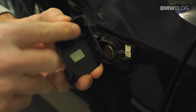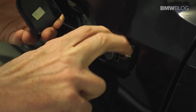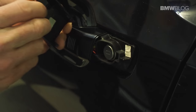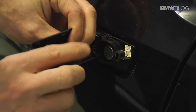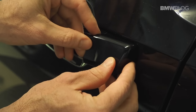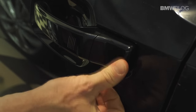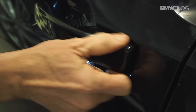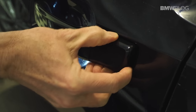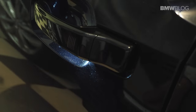I find if you look at these two little notches here and you hook them in here and snap it down, that it works a lot better and then you're less likely to break this little tiny piece and have to buy a whole new one. So just slightly hook the top on and then snap the bottom on. And then you want to make sure that it's nice and flush and you can't really tug it off, because when you're going 55 miles an hour down the road you don't want it to come off.